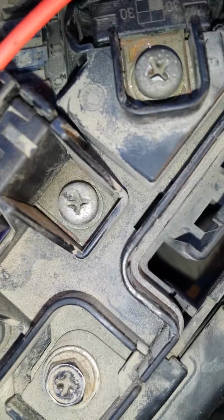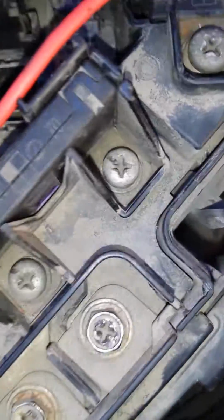Let me take it up and show you. I just use this pry stop. So there's the wire in that one. So put the ground in, put in the relay, push it down, run it to the ground and the battery. Remember the ground. So yeah, look, and that fixed my problem of cranking and no start.